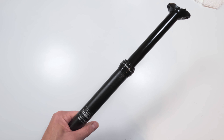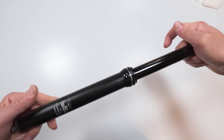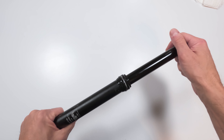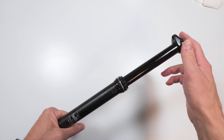At the end of last winter, beginning of spring basically, I noticed there was some sag on this dropper. There was an oil leak at the bottom — the damper inside obviously has a leak in a seal and that is negatively affecting it.